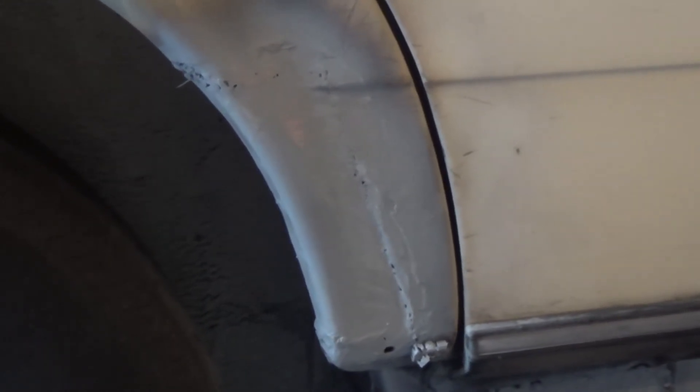I've also got the front section done here. Once again, it's definitely going to require a little bit of filler, but not too much. And basically for my first time attempting to weld on exterior panels, I'm actually pretty happy with this. I'm definitely going to be able to smooth this out a bit. I've got this stuff coated in some primer now. And although I'm basically calling it quits for the day, I'm going to come back out here in a little while and start seam sealing everything. But for now I just need this primer to dry up a bit.